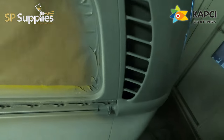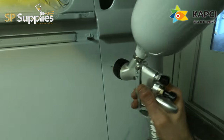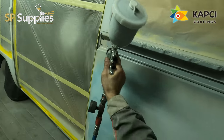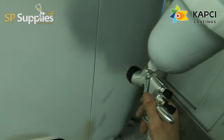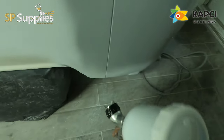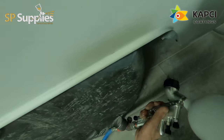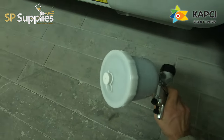It has no issues firing out primer really thick and heavy, putting down a really nice wet coat — especially on a big area like a bay window camper van where you want to put a lot down quickly. This took me roughly about 10 minutes per coat, so about 20 minutes in the booth for two full coats of high build over a full bay window — more than quick enough. With a little more thinners it sprays smoother, but here we were going for build, not smoothness.